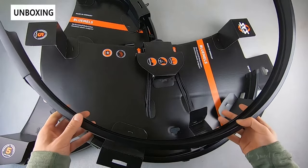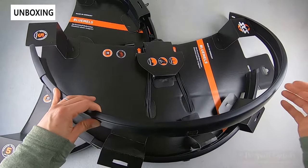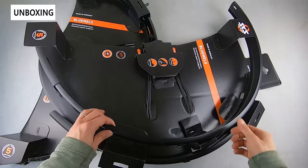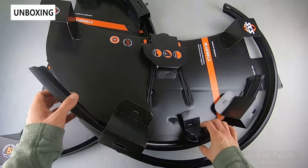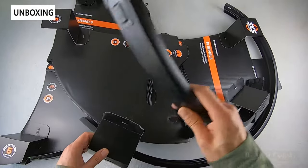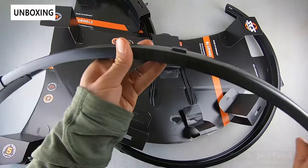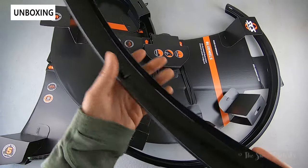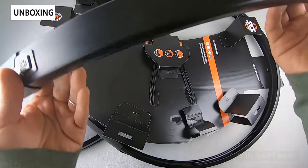These have a breakaway safety system with the stays, which is pretty cool. They're designed to actually rip off the stays if a stick or something gets stuck, so you don't end up falling when the wheel comes to a complete stop. The fenders are aluminum and plastic construction — a thin piece of aluminum coated in plastic — which gives durability while keeping the weight really light.